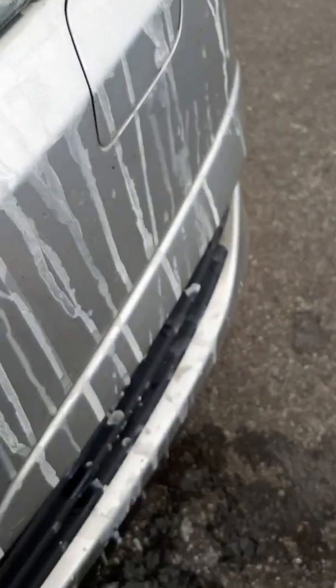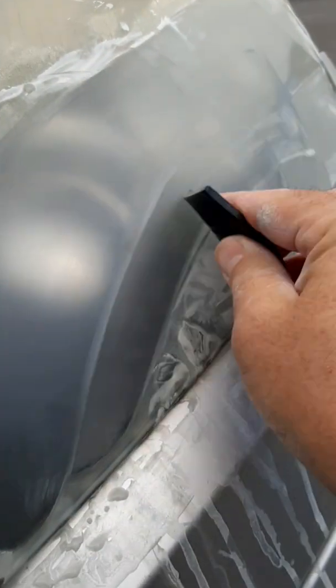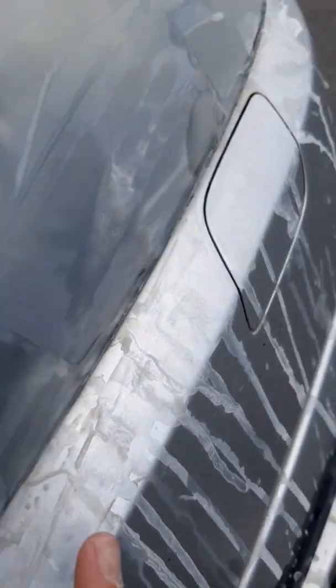As can be seen, progress is being made. Taking the yellow off, I'll just squeegee across it to be able to see better. Yellow, which you can see up the top quite clearly, is coming off lower down. A little patch left there to do. That might be better done just without the flattening block, just to be able to focus on the edges of it. Take that off.